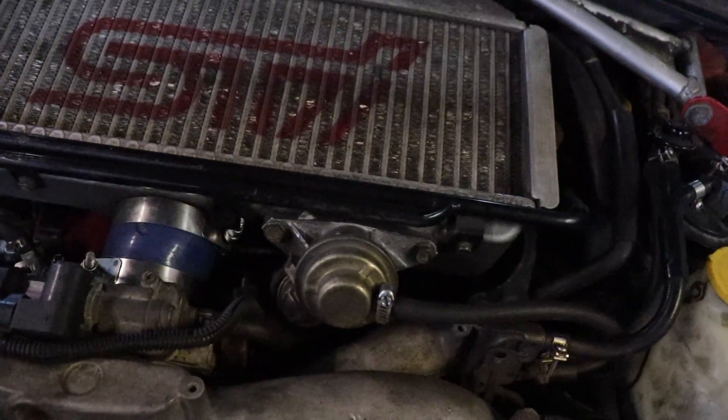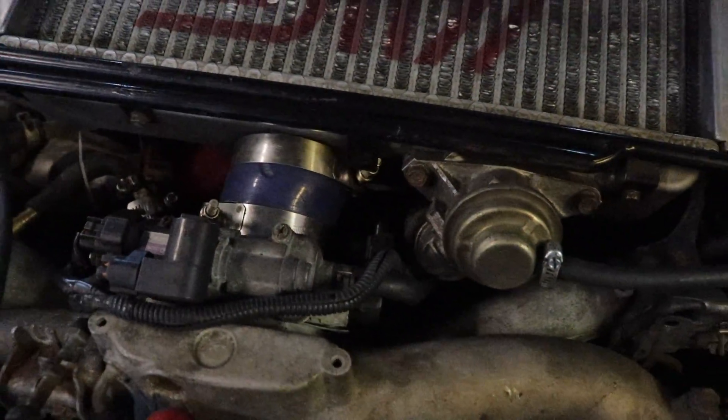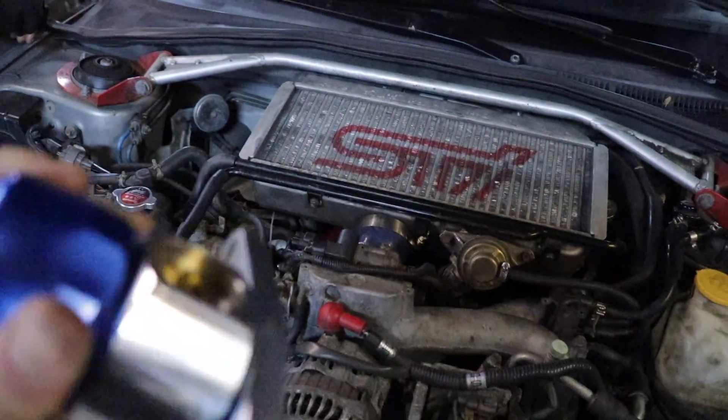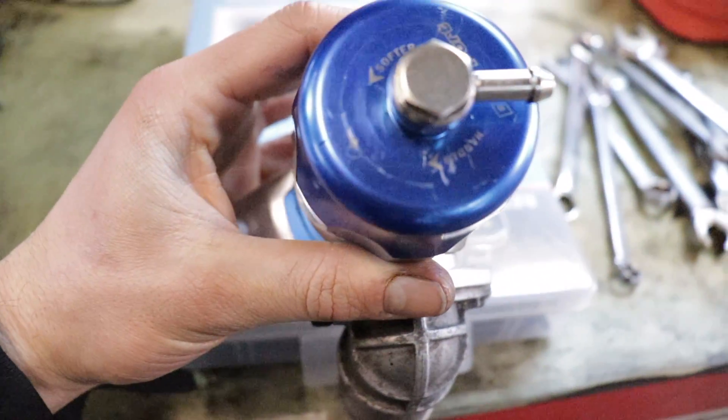It's pretty simple. The difference with this one is it actually has an external valve, so instead of only blowing back into the intake, it actually has this one on top here that escapes into atmosphere. So it's definitely gonna be a lot louder. This blow-off valve is also adjustable — as you can see on the top it has an indicator for softer or harder.